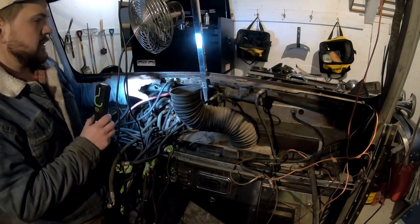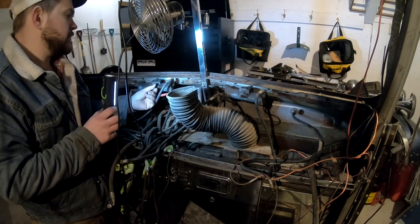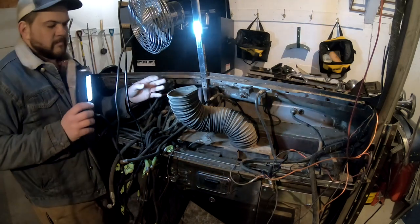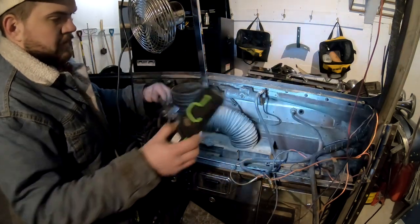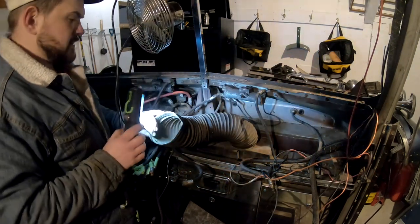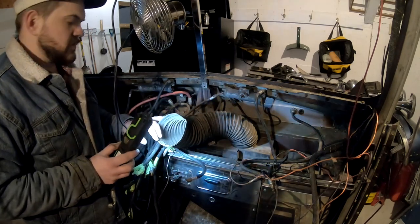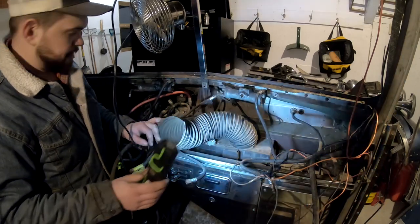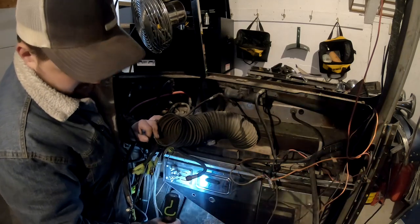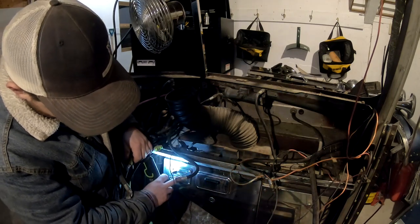Right here and here are the two wiper motors - both are driven with air power, with a line off either end. This is the only heat duct in the entire truck. You will have heat coming out of the bottom of the heater core for the floor because you do have defrost floor here.